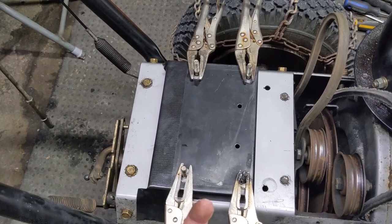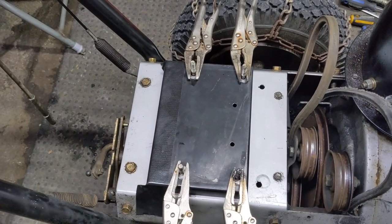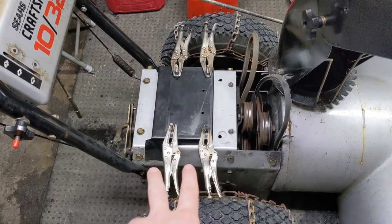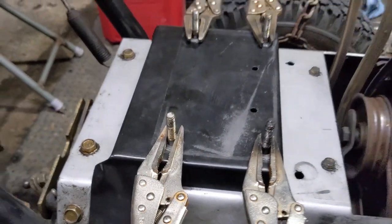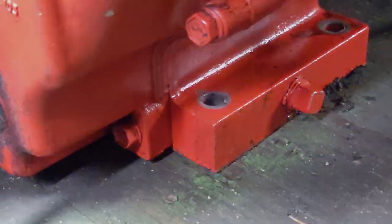Normally the bolts come up through, then we have some spacers that go on each bolt, and then we have this lifting plate here — we just have that taped into position. We won't be able to set the engine down on top of these locking pliers unfortunately, because the thickness of them ends up being just too much — so the threads would only come to about there. I've already measured that.